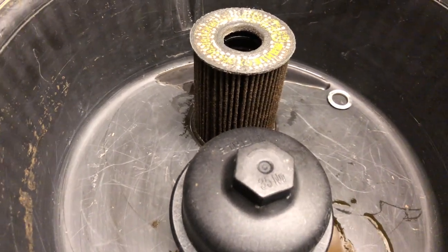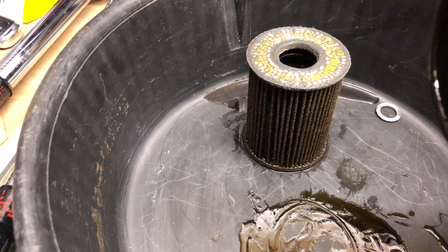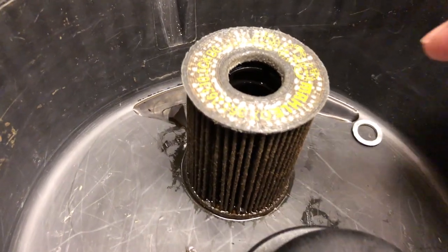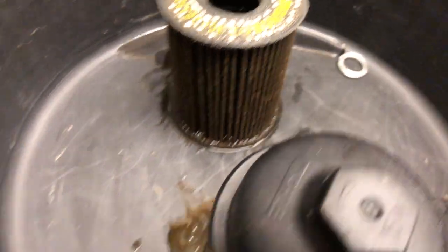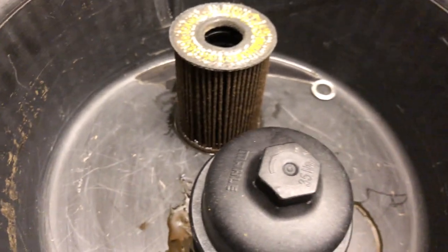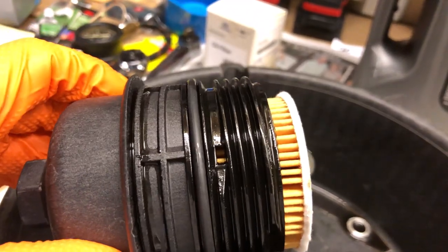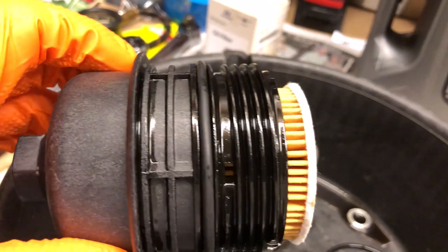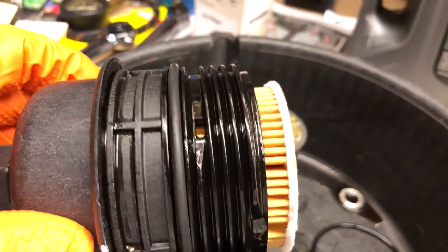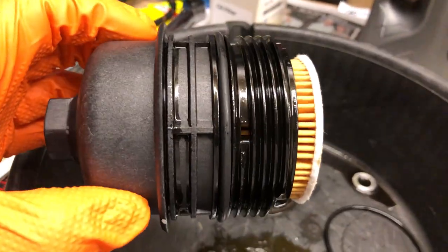It's going to be a very light, snug setting — the o-ring is what seals it. All you need is to get the o-ring seated far enough. Make sure you note where the o-ring goes before you remove it — it does not go in the groove that has the holes for oil flow; it goes in the groove above it. If you put it in the bottom groove it would be loose and would not seal.